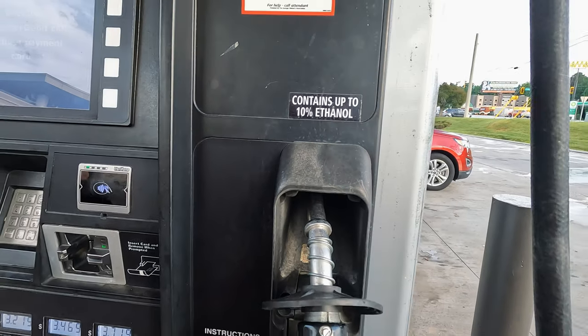It's pretty simplistic. To get my desired E30 blend, we have to give the app some information. First, we put in the fuel tank size of the vehicle — in the Mustang EcoBoost it is 15.5 gallons. Then we put in the ethanol percentage of the pump gas, the 93 that we're also mixing in. Most of the time that's gonna be 10% ethanol — you'll see stickers on a lot of pumps that say 'may contain up to 10% ethanol,' so it's a pretty safe bet. The next box is ethanol percentage at the pump, which is where we input the number we get from our test kit.